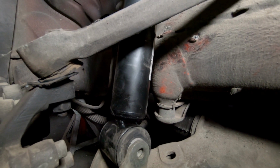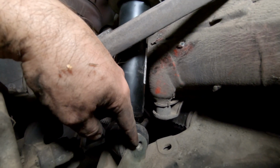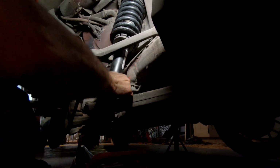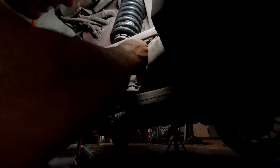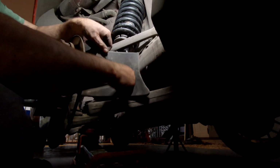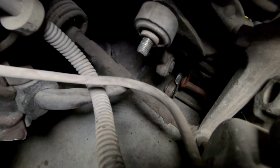So at this point, I'm going to try to fully mount this lower shock bushing to the control arm and get all that set up. Not tightened, but at least get the bolt through it. Use the little thing up just a touch. Screwdriver. Let's kind of help line this thing up here. That went all the way through with ease. So you'll see how that's dangling back here. So that's what I'm left with.